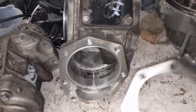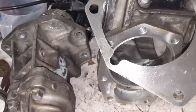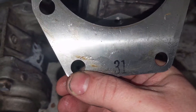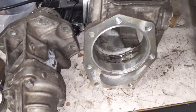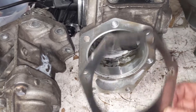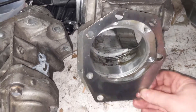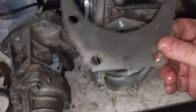Two of my transfer cases I've got lying around — one's in the car, the other two are here — don't have a shim in here, but this one does. And it is exactly — I've measured it — 0.31 of a millimetre. So when this transfer case was being built at the factory, they realised after assembling it that the height of the ring and pinion wasn't correct, so they installed this shim. They must have had a bunch of these at the factory.